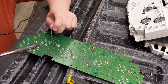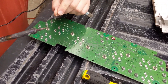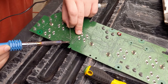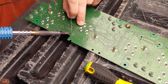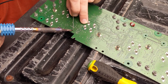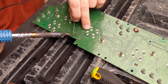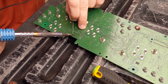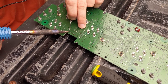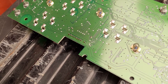Those joints are the things with the issues that go wrong. The main thing is these two outer posts that actually rot out, but we're just gonna solder them all just to be safe. Touch your solder to your iron, make sure it's hot enough, get it tinned a little bit, and just hold it to it. Once it gets hot enough the solder will start to melt — then just stick some solder to each one. That one took a little bit of solder — it's getting to its melting point, so stick a little glob on there. You're just gonna do this the whole way down. If you get some solder on your iron, it will actually make it heat up faster. They're all re-soldered, ready to go back in the truck, and the odometer should work now.